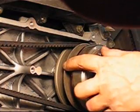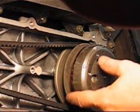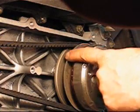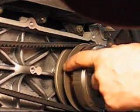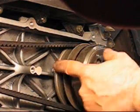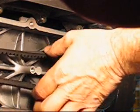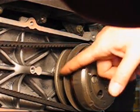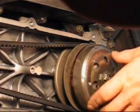The way to do this — you see, this is the outer part where the belt goes in, and this here is the inner part. So what we need to do in order to loosen the belt is to squeeze the outer part towards the outside, towards the clutch. This is the clutch.